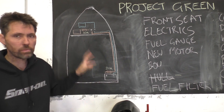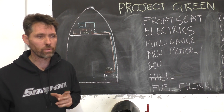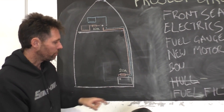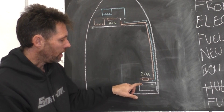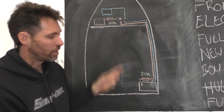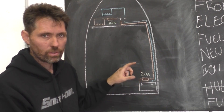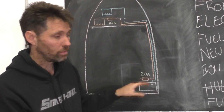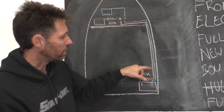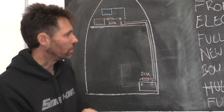I've got a little bit of a plan of the backbone of how I want the wiring to work. In the starboard quarter I'm gonna keep the battery here so it's nice and close to the motor for starting. And then I'm gonna run some 12 gauge wire from the battery up to the front. I'm gonna put a 20 amp fuse straight away from the positive terminal to that wire, so if anything goes wrong along these wires or chafes through, that'll blow straight away from the very start rather than melting the whole lot.